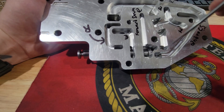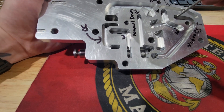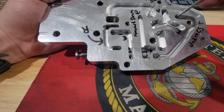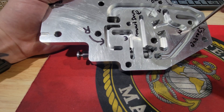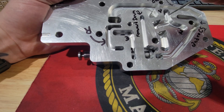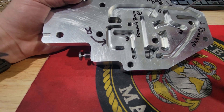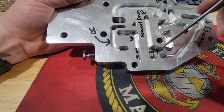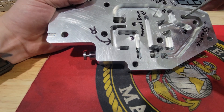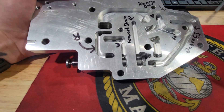When you shift into second, the forward drum is still spinning but now we're applying pressure to the center support via the center bolt, activating the intermediate clutches. What that does is violently stop your direct drum — it's just sitting there in second gear, not moving. That's how you get second gear. The direct drum immediately stops, and that's why they can pretty much explode under a heavy duty amount of power.